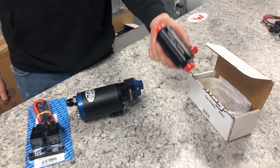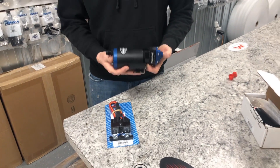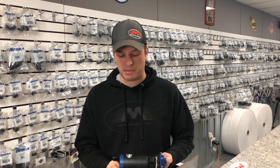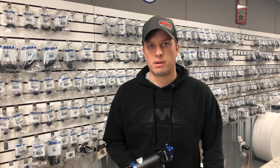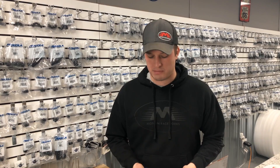The last question I get on these pumps is: where do I have to mount this — does it have to be below the sump on the tank? MagnaFuel says you can mount this thing 18 inches above the sump height on the tank, which means you can mount it up on the frame rail — even if your sump's down lower, it's actually going to have a siphoning effect. So don't feel like you need to mount this underneath the car where it's going to rip off when you do a wheelie. That gives you a lot of versatility. I always try to keep it between a foot and a half and two feet from the actual sump as far as how far forward it is. Obviously the further back and lower you can mount it, the less hard the pump's going to have to work to pull that fuel. But you certainly don't have to mount it below the sump by any means.